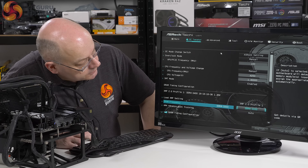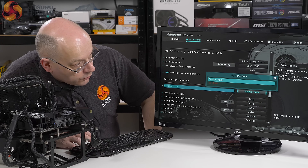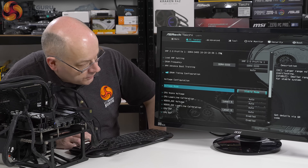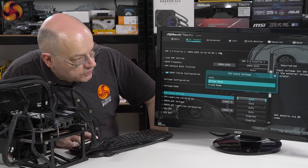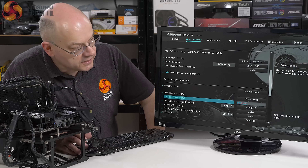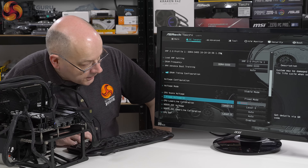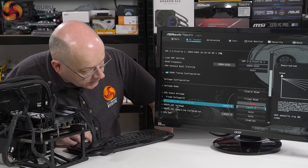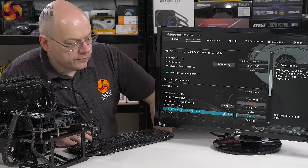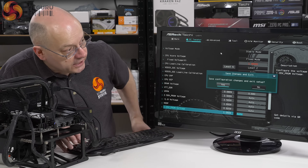BIOS time — I've got the latest P1.30 BIOS. On the info screen, going across to OC Tweaker: change the overclock mode to manual, leave the front side bus alone, change CPU frequency voltage to manual. Set CPU frequency to 4.25GHz — I know that works. CPU voltage 1.4, SMT left enabled, threading enabled. Enable XMP profile. You'll note the memory is now at 3333 — the Sniper X memory is actually 3400, so XMP on this board is incorrect. I've used the same memory with Gigabyte boards and had no trouble at 3400. Going down to voltage configuration: stable/OC mode allows an extended voltage range; I don't need that. CPU voltage fixed at 1.4 — just under 1.4 is absolutely fine. Load line calibration set to level 2, SOC voltage on auto. F10 to save.